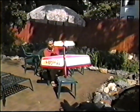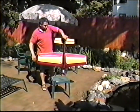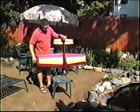Now while this dope is drying, one of the things Kenny's doing, and it's a good idea to do, is we call it rotisserizing. Just keep moving it in and out of the sun. Don't hold it in any one dimension, any one time, because the heat can bubble the paint. But if it's constantly moving like this, you get an overall that it dries a lot better and you don't run any risk of having a bubble. And with some pretty bright sun here.